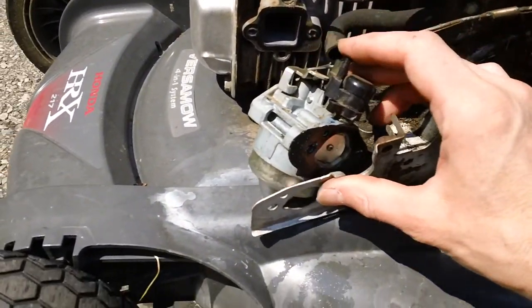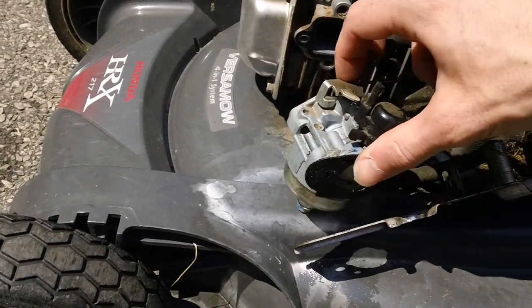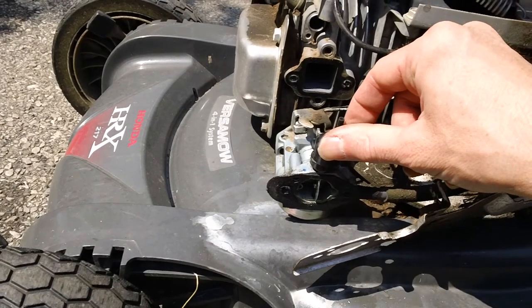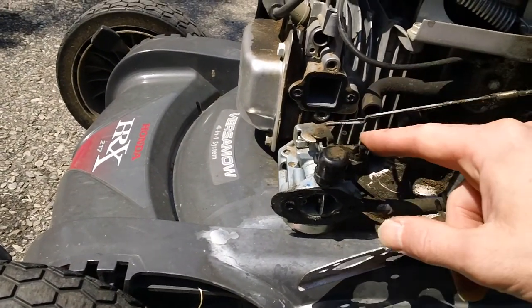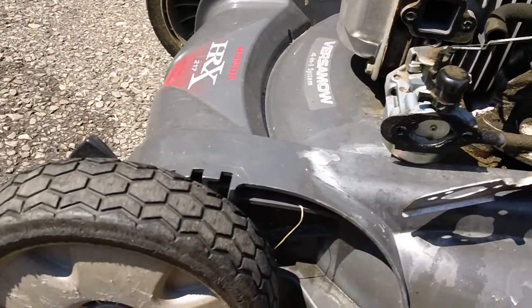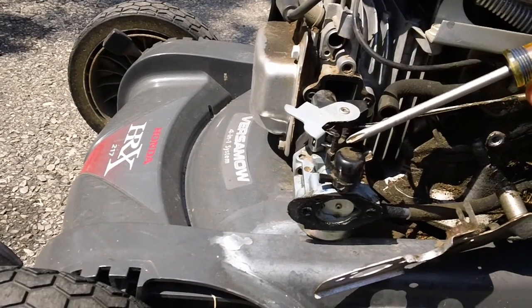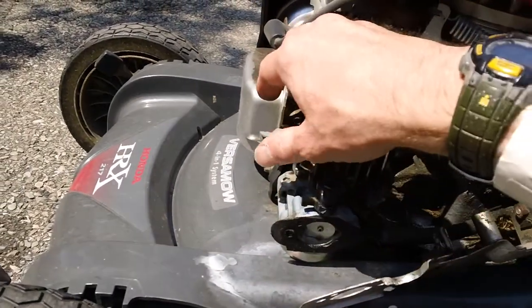This little black cover opens and closes on the carb as well. So when the engine starts heating up, this thing opens up to the full choke-off position — the choke is fully open. When the engine cools down, it closes back up. That's how the automatic choke functions. This rod contacts this piece, which pushes the rotating mechanism to rotate open — that's your open-and-closed auto choke system.